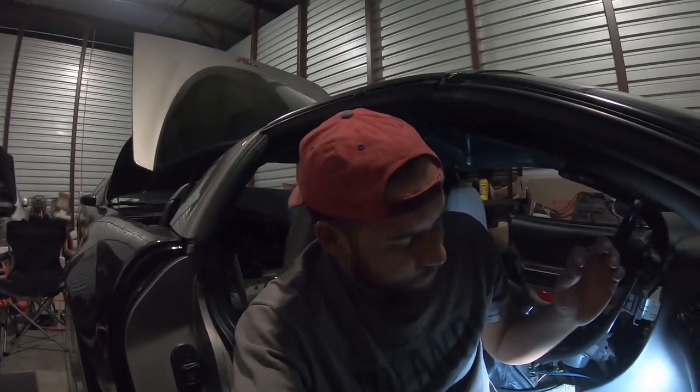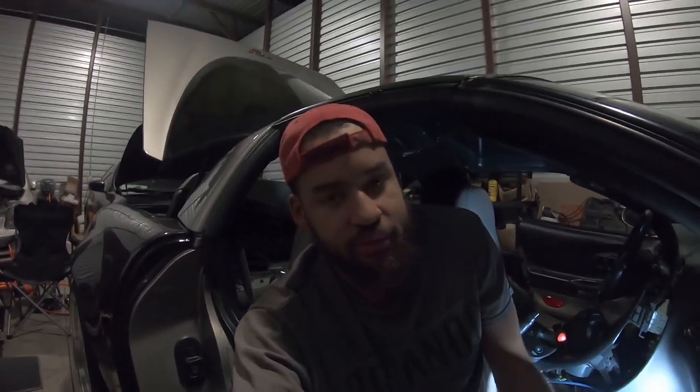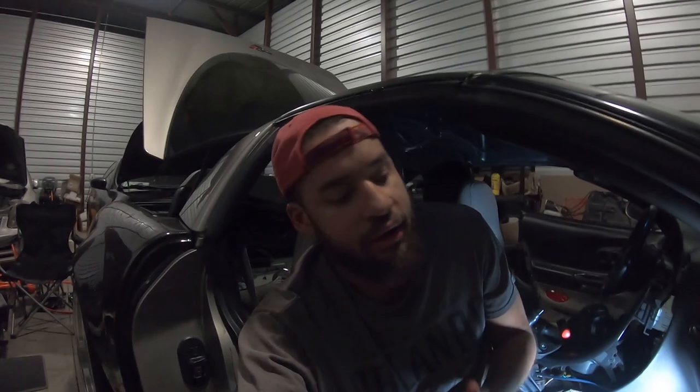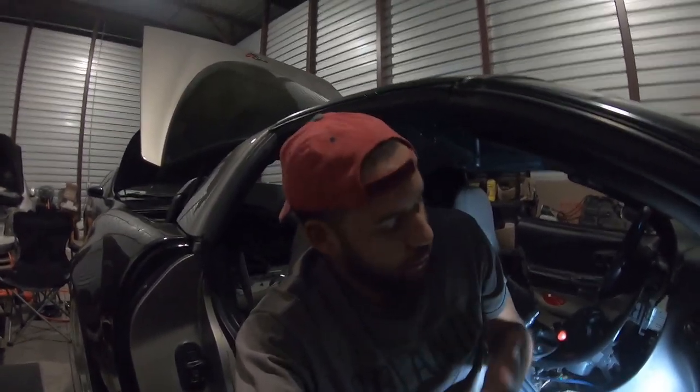But the reason I'm not running it next to the power wire is because you're not supposed to do that, because there's a chance it'll give you sound coming through your speakers from the power wire. You're not supposed to run anything near the power wire. That's why we're having to run the wire like this.